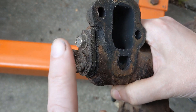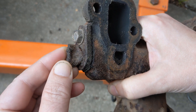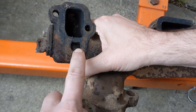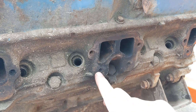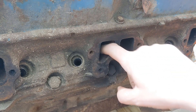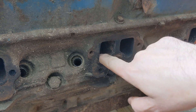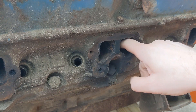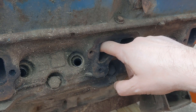Real commonly, since the smog pump was removed on this, they also just smashed this closed — basically broke it off and smashed it over so that exhaust going through here doesn't come out. If we take a closer look, you can see it's got a hole here on this pad, just drilled, and it comes out. Stick your finger up in here — there's a hole that comes out right next to the exhaust valve, and again over here. It's angled and drilled straight through to here.